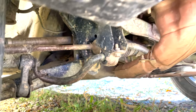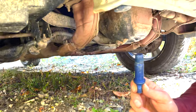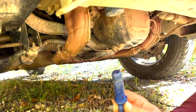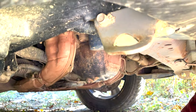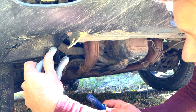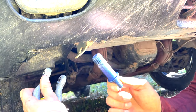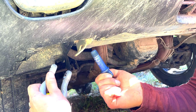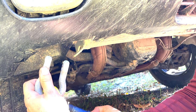What we want to attach to is going to be further forward on the frame if it's a full-frame vehicle, or there are going to be little loops attached to the unibody structure. Right here on the front there is a little loop, and on a lot of vehicles if you do anything off of paved roads they may be slightly bent over. That's why a shackle is nice — it's just a pin that you can put through a very bent loop, whereas a hook may sometimes not fit any longer.